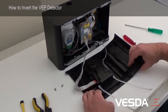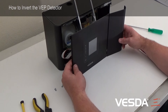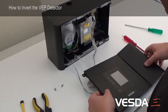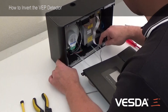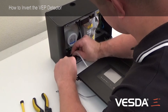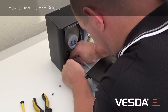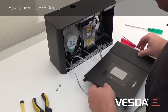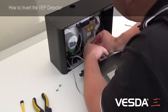The last thing to do is stand our door up — we can see that it's the right way up — and put our tethers on. We want the door to loosely fall down when we take the door off, so we'll lay our door flat and put our tethers in the slots. There's one slot there and another slot here. The best way to put your tethers in is to bend them back around themselves, put them under the tether openings and bring them up. It's a little bit fiddly but it's the best way to do it.